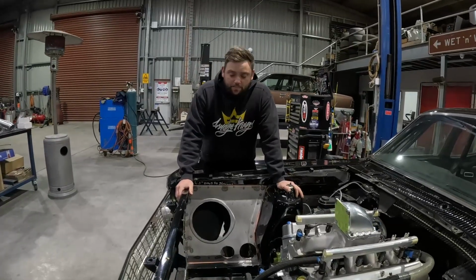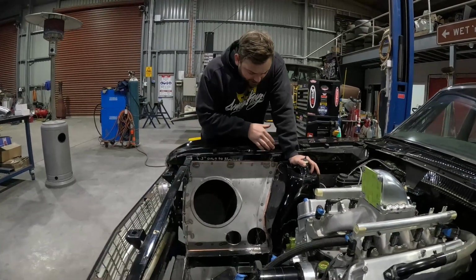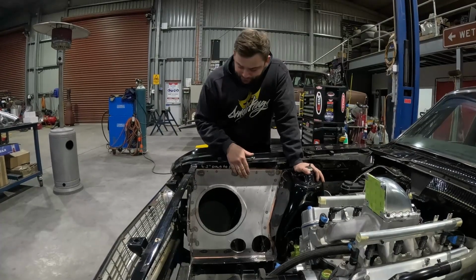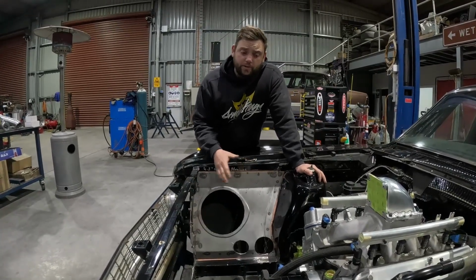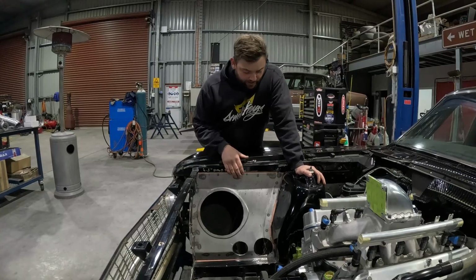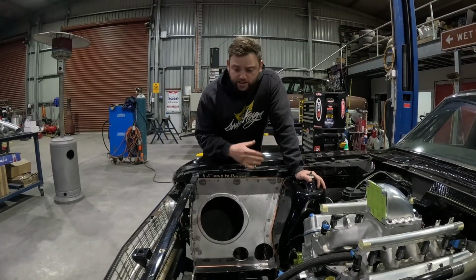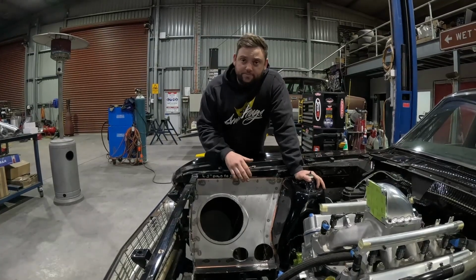So we've just buttoned up the side panels. So as you can see, they're all welded. That's all these burn marks. They're all welded in, plug welded from the back. We're not going to bother about cleaning them up right now. We're going to keep on getting after everything else. But all the copper paint is behind it, protecting all the raw metal between the two to prevent rust.